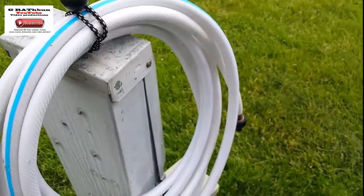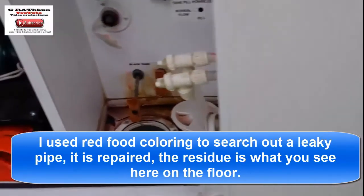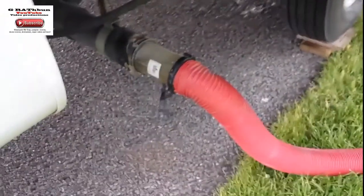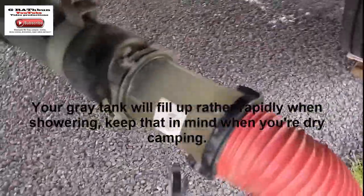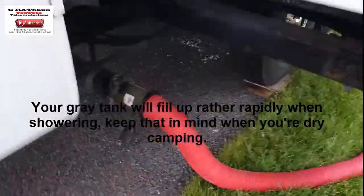Once there's nothing going down through there, we got it. I use these little bungee balls for everything — they work great, hold your cords together. Now that it has drained and it's clear, we know it's pretty clean, so we shut the black valve. Now we open up the gray tank — the reason we do that is to flush anything out of the pipes and out of this line, so the last water going through it is relatively clean.